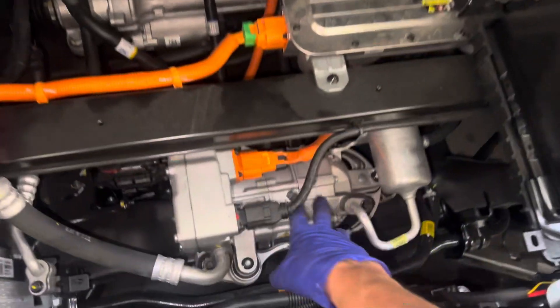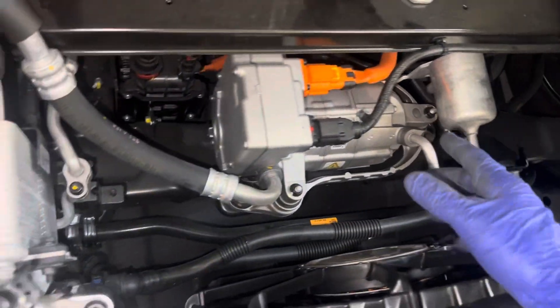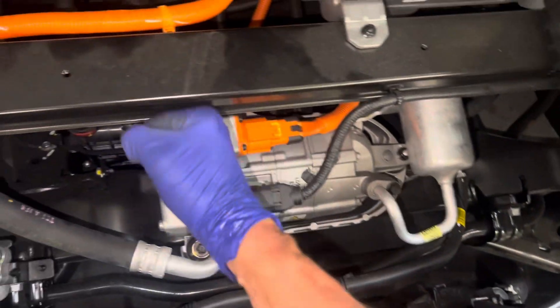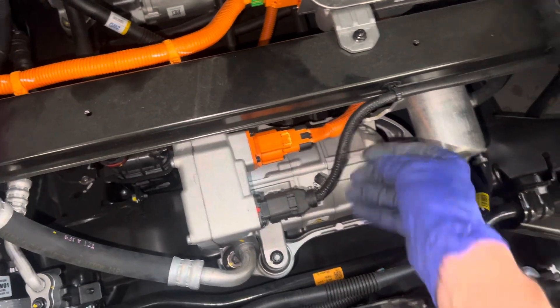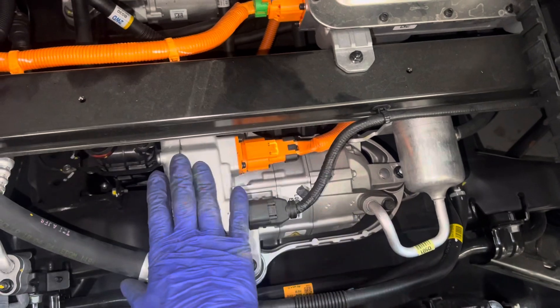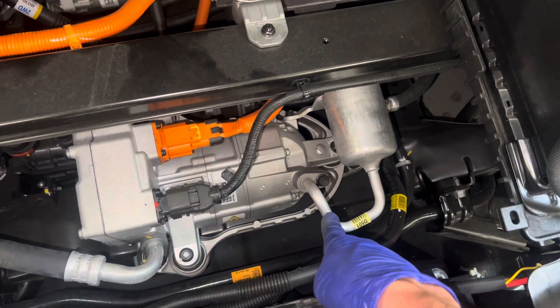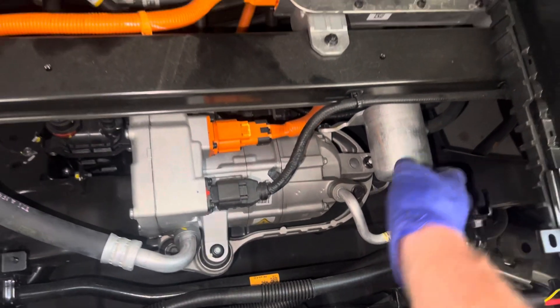We've got a pump, we've got an AC compressor right here. We can pretty well look at it and guess — we've got the inverter here, so we'll have our couple hundred volts right there. It's only two wires coming into the inverter; that'll change it to three-phase to drive the electric motor. We see the small pipe, so we know this is going to be hot discharge gas right here.